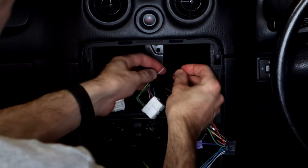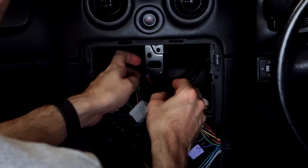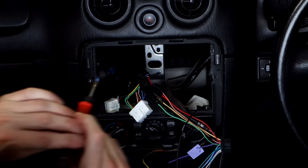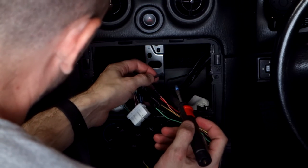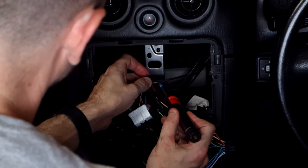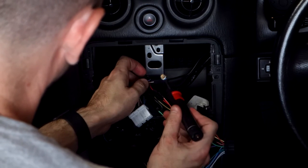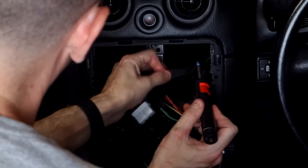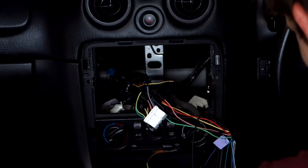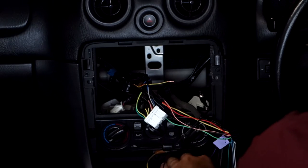Alright, so if you're left over with any wires that you're not using, you just put a bit of heat shrink over the end of it, like that. You will burn yourself doing this, but not badly. Just leave it halfway across, so it's poking out like that, and then heat shrink it. Then just pinch the top out. There you go. That stops it from shorting out against anything. This is really handy if you've got a car that you don't have a wiring diagram for.